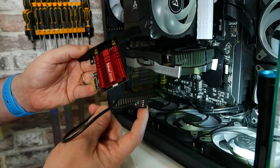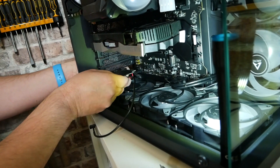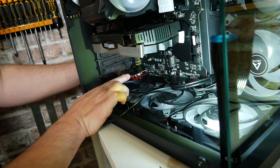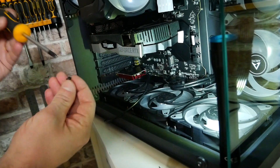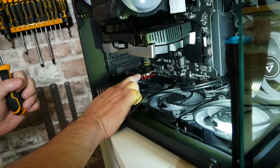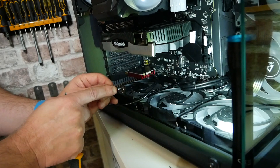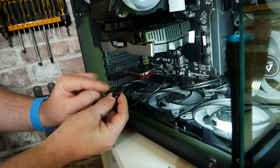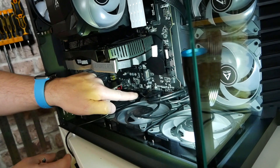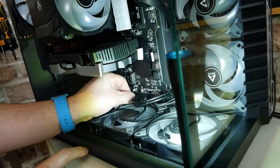Now we can put the card into the PC — pretty much the same as any PCI device. Line up on the back, line up with your PCI Express port, and gently push it into position. It should snap into place. Then all you need to do is replace the screw from the back and make sure the card doesn't wiggle — make sure it's firmly into the slot. The next part is the USB header connection, which has that traditional 9-pin connection plugging into our motherboard. On this particular motherboard we've got a USB header down in the bottom section, between the existing USB 2.0 and USB 3.0 connections.